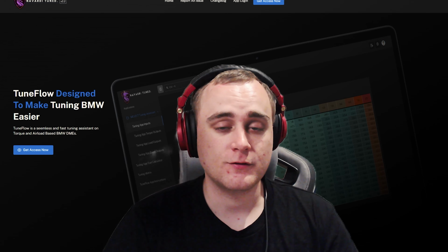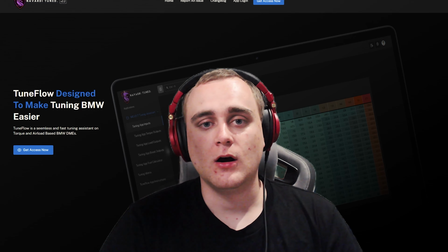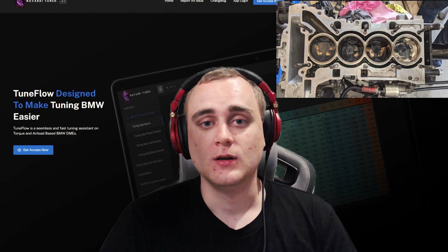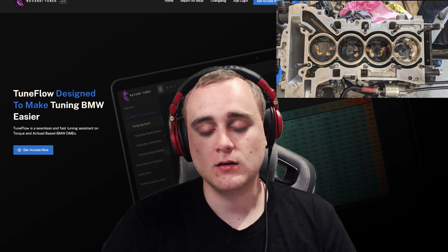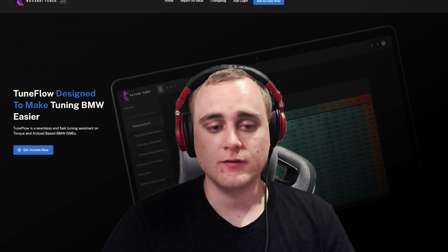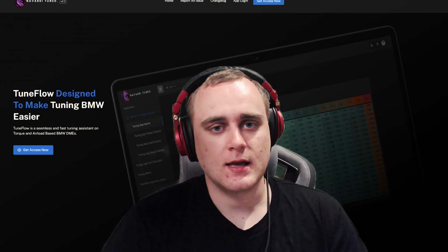Now, we have seen some success with flange liners, and we have seen some failures with flange liners. Notably, I'll chuck some photos up now of an example of flange liners that was unable to handle 33 psi and give or take 400 horsepower in Dynojet standards. Granted, this car did have some issues with the fuel pump giving up, and we had a lot of lean conditions. But the problem is that the sleeves cracked, and they shouldn't have cracked.